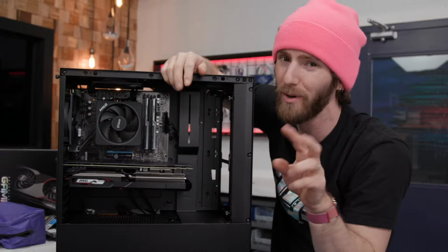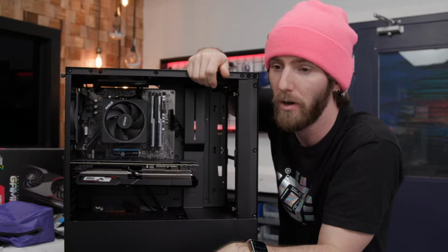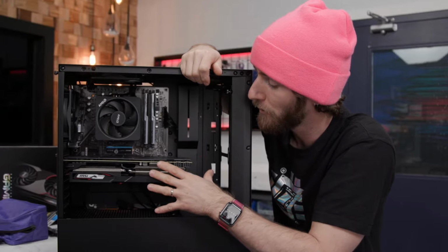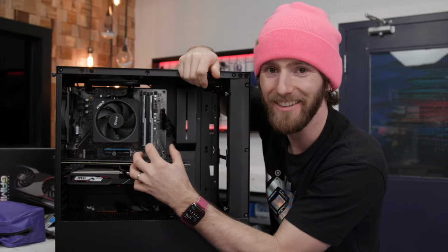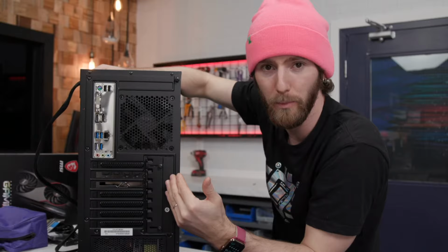EPYC is technically an SoC. There's no outside chipset. So for PCI, if I recall correctly, your PCI controller would have been on your North Bridge. We used to have two chipsets on the motherboard. So what that means is anything connected to it is still connected to the PCI controller over the PCI bus, regardless of whether it goes into a slot or if it was pre-attached to the motherboard. Because it's all just wires, right? It's the exact same thing.